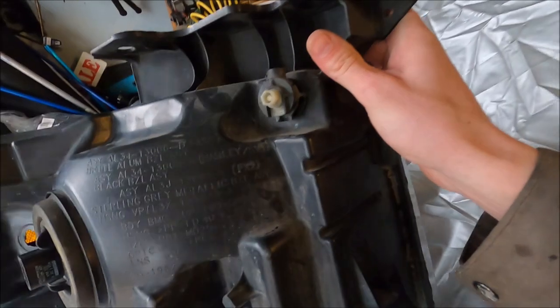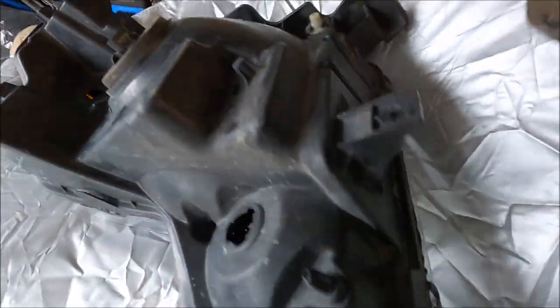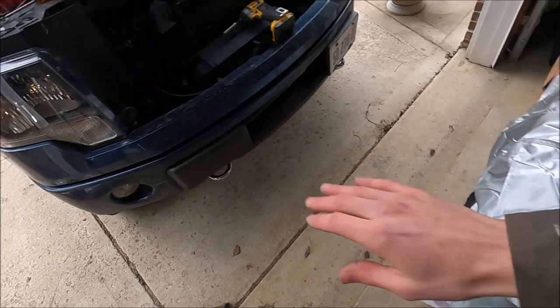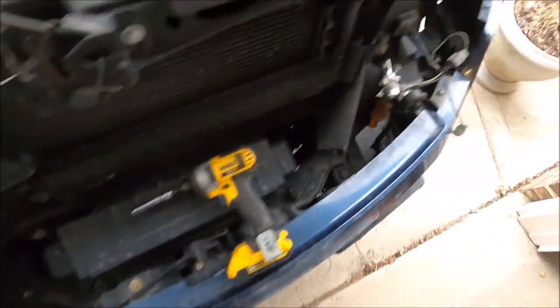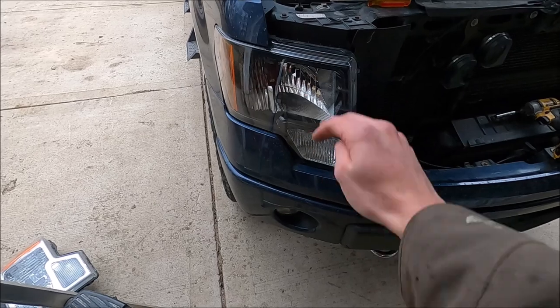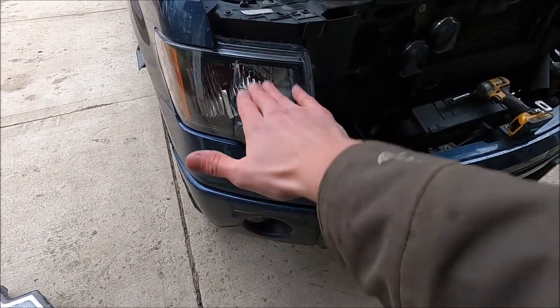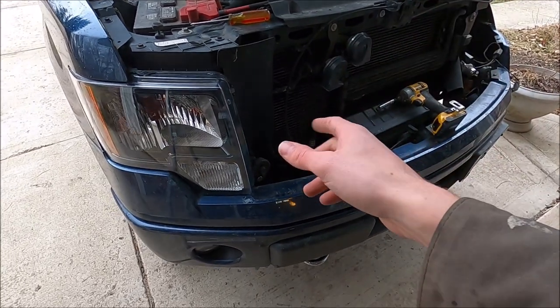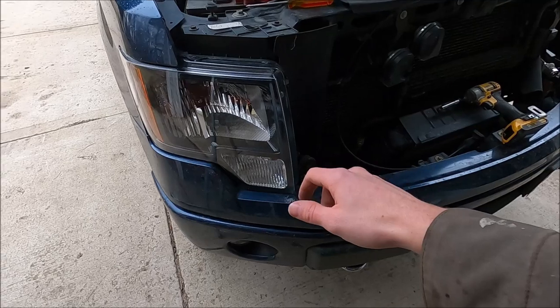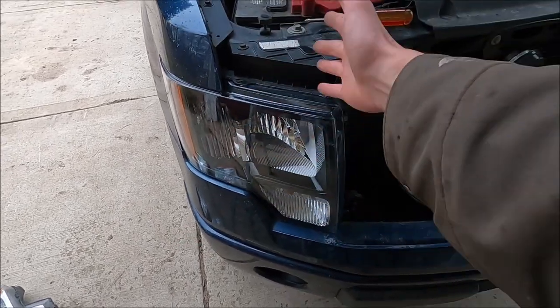Before I put this headlight in, I want to show you the headlight adjustment for the up-and-down angle. Once it's installed, you're going to put the screwdriver down into this hole and twist left or right to adjust the headlight up and down. It's going to be right in this little hole, and I'll need to do the same on the other side. These headlights need readjusting because the truck was leveled, and Raptor headlights from a taller truck are probably pointed way down. In the video where I installed the LAIS Fit lights — I'll link it above — I did all the setup, so here I'll just show the adjustment.